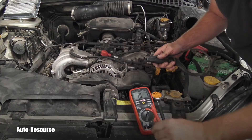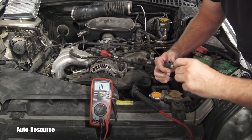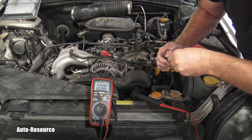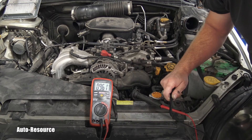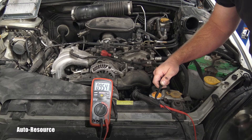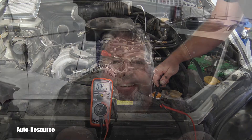Click, click — and let's see, you will see for yourself what the reading is. I'm touching the steel parts and holding it. What is it? Nine point six kilo-ohms. So we have a comparison — that's the number we're supposed to see. There is continuity and the resistance is within the expected range. But we know that the number one cable is definitely bad.